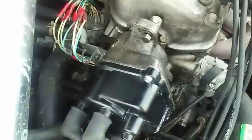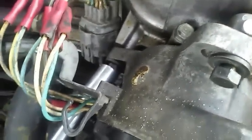Okay, so I got the top bolt loosened. I'm going to move my short rim out of the way and come behind the connectors right here. You look down there on the distributor and there's another bolt right here — put your socket right on that bolt, same thing, counterclockwise. And it's loosened. Okay, so I pretty much got all my bolts undone.